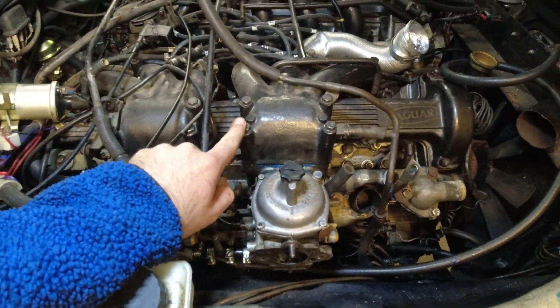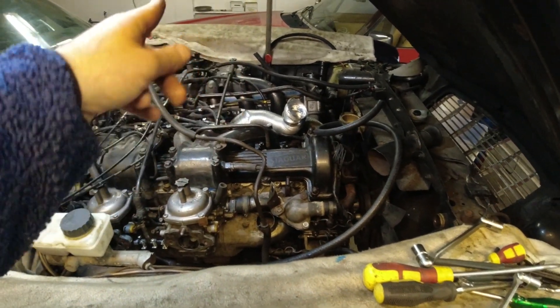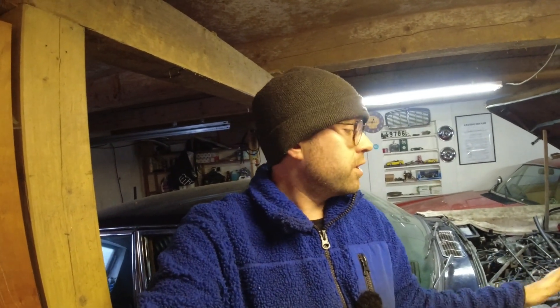All that's in place now, all tightened down. I also put the thermostat housing back - the last one. Really what's left to do now is the top hoses and a couple of small hoses over there - that's pretty straightforward. Fill up the coolant system - I got new caps for it. I want to show you guys these little hoses back here that are a little bit tricky to get to but very important to change if you have a carbureted V12. Anyway, that's it for this video. We're getting very close to the owner picking up this car - it's really fun because he's never actually driven it when it's worked as it should. One thing left to do is the rear suspension - when I tried to lift the car the suspension stayed on the ground, so the mounts are completely shot. I'll show you in the next video how you can replace that in place. It's a little fiddly but very important to check those mounts so you don't go out driving and hit a bump and lose your rear end. Anyway, if you like this video please give a thumbs up, share with friends, and if you're not already subscribed please do subscribe. It really does help out a lot. Until next time, I'm Adam, this was Lomific Classic, I'll see you soon.